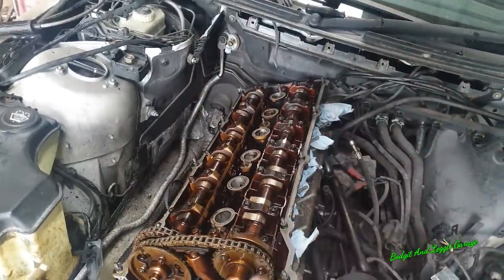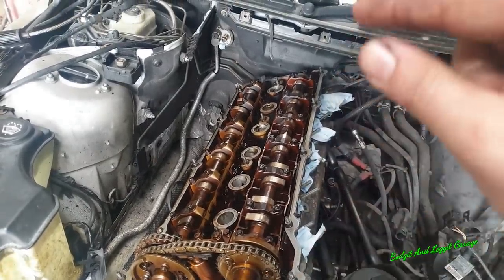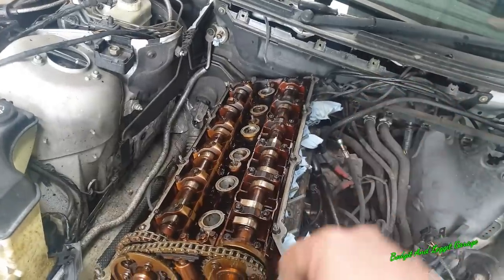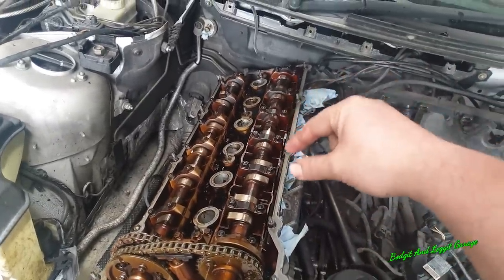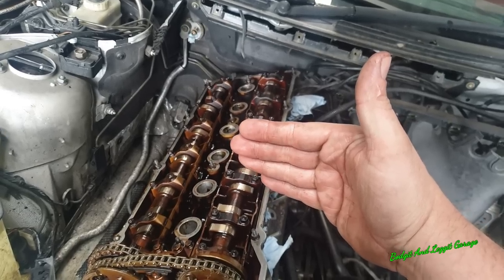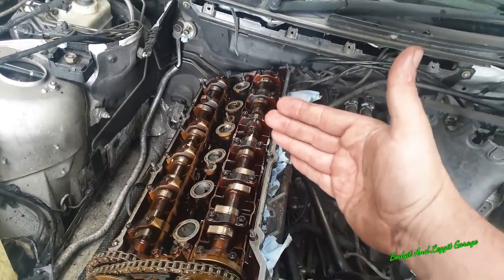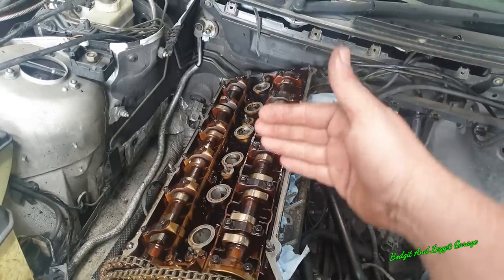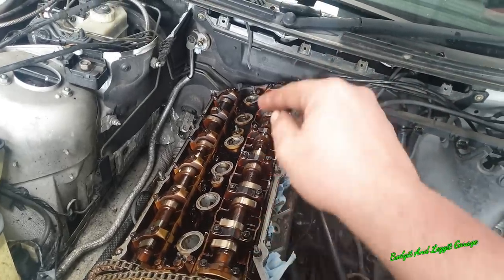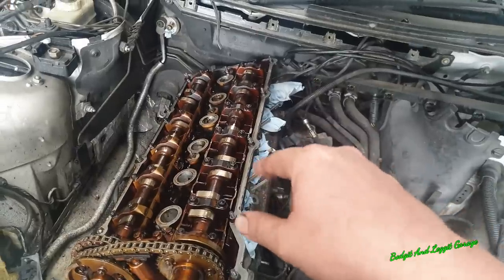We'll take it off then and turn the head around and measure it. But I just want to see if the threads are pulled, and one of the easiest ways is to crack them and put them back down. We've also got to use an electronic torque wrench, and I'll show you the reason why. When you're using a digital torque wrench, if the bolts are stretched or the threads are pulling, as you're tensioning it, the torque wrench will hold the torque and it might start loosening. So let's say we go to 100 newtons, it might go to 90 and then all of a sudden start dropping off. The bolt's still spinning, but the reading on the torque wrench might be going 89, 88, 87. That will give you a good indication that the threads are being pulled. You don't get that with the old traditional torque wrenches, but with the new digital ones, you do.